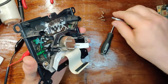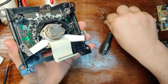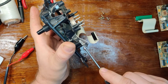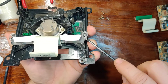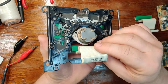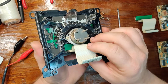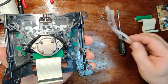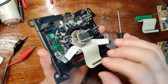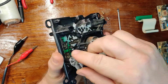It's quite simple. Two screws on the illumination bar. Sometimes they stick. If they stick a little bit, ever so gently pry just a little bit up. Then rotate towards you and the LCD just comes right out. Pretending this is the new one that we just wanted to change, let's just reverse order. Gently get it lined up. Get those two pins. Gently press down to make sure that the LCD is not in a bind.